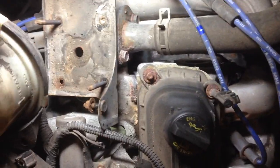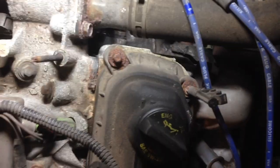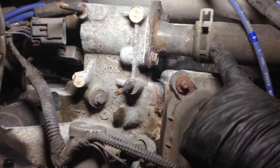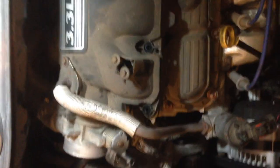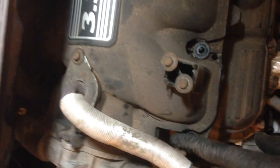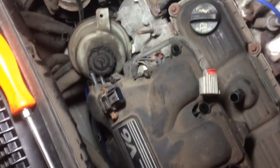We'll put the coil to the side and keep that power steering reservoir out of the way. We lift off the base of the coil and now we have a lot better access to the intake manifold. We're gonna take off the upper rad hose and pop off the sensor over there, and then we'll be taking off the upper intake very shortly. I've taken out all the bolts — there's eight of them in total, four on the front and four on the back side. There's also a vacuum hose right underneath here connected to the bottom of the throttle body. Once all that's done it's pretty much free.